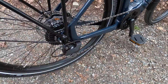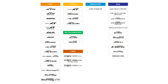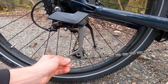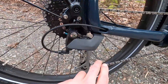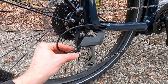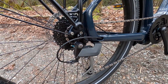There's also an aluminum alloy derailleur guard — not steel, which could rust. We do have a decent Shimano Alivio, which is several steps up in the Shimano group set ranking, with a long cage derailleur. It doesn't have a clutch built in, but it should be pretty reliable. There's a little barrel adjuster here — over time, as the cable housing seats in, you can turn this to the left to essentially lengthen the housing and make up for any slack that's given up over time.